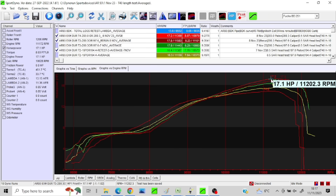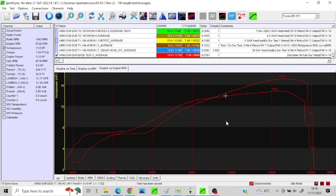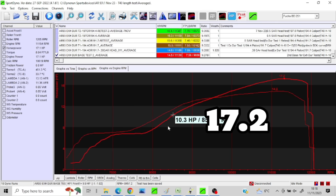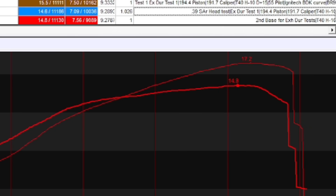To note: I spent a little less effort raising the entire roof — I raised it more in the middle, trying to give a bigger radius on the top of the roof for piston ring longevity. That could potentially have been the limiting factor. So we started at 14.8 hp and we're now at 17.2 hp. We have lost a little low-end drive but gained a little overrev, and gearing should hopefully mitigate that.